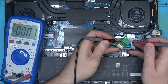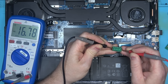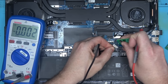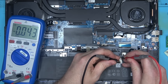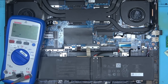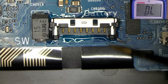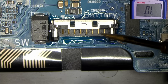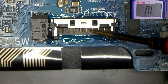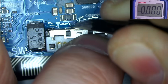We now know for a fact that the battery is good and should work. We're able to read the voltages with the battery plugged into the adapter, and that's important because my adapter is special — it forces the battery into thinking it's plugged into the laptop. Some batteries require the present pin to be grounded in order to output voltage, but even without the adapter the battery has voltage, so there's no problem with the present pin. However, when I measure that pin on the board it reads open line, almost as if it's not connected anywhere. So I tried to run a wire forcing this pin to ground and attempted to power on the laptop with the battery.